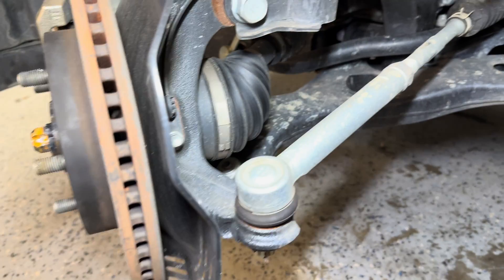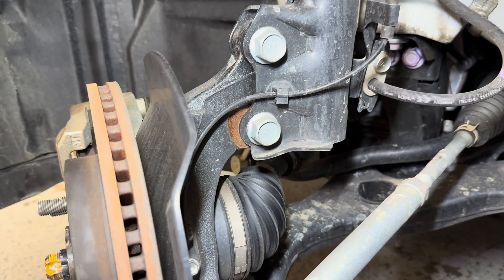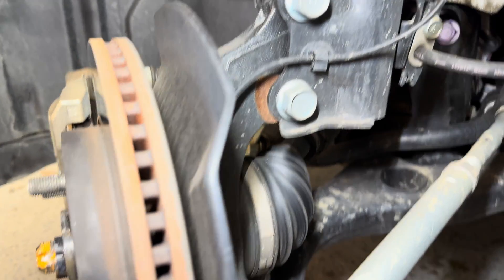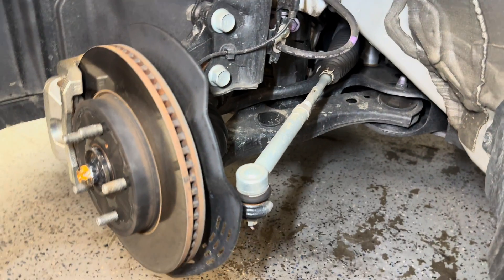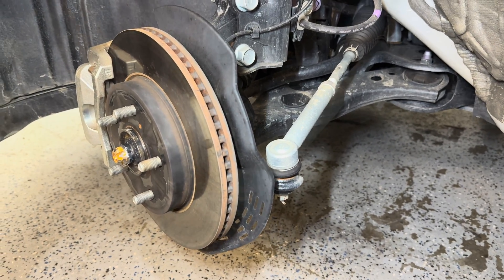This is a pretty common design for Toyota front-wheel drive vehicles. We employ a McPherson strut setup, and the steering rack assembly appears to be something we've seen on a lot of recent Toyotas including the GR Corolla, which may open up some options for upgrades for people that want better steering.